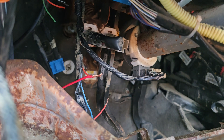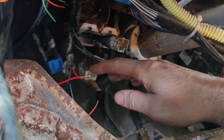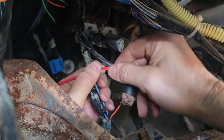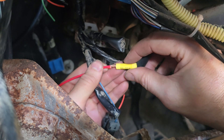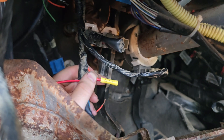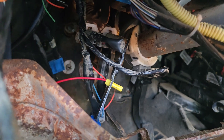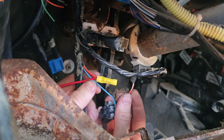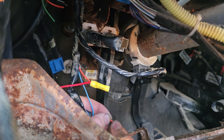Apparently I didn't hit record. So in summary: we snipped the wire that was up there — the battery is disconnected right now. We have another piece of red wire I'm going to twist into there, and then everybody's favorite butt connector. Butt connector on there. We're lacking on space under here, but that's in there good. The other side of the butt connector, we're going to put back in our donor wire harness connector.